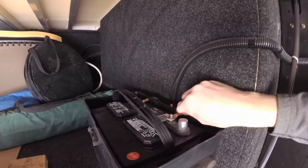I'm just going to turn the fridge onto propane for right now and make sure the propane lights. Then we'll try it on electric after we make sure the propane works. We've turned on the propane and it's saying no propane coming in, so I'm going to check and see if we're getting any flow from the stove here.